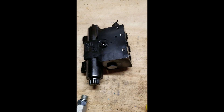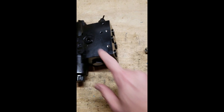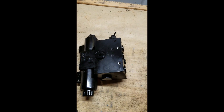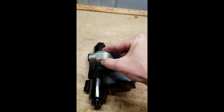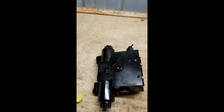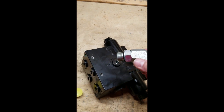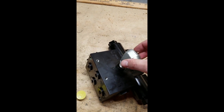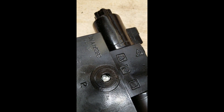Per the directions, the next thing we're going to do is prepare this valve — basically just putting some fittings in. In this section here we're going to have a 90-degree elbow coming off like that. And then on the back side of it we're going to have another fitting, same elbow, pointing straight down. Remove these blanks — looks like a hex end — and get these oriented to how they're supposed to be. The directions say to keep them loose.